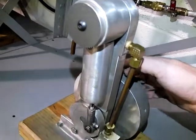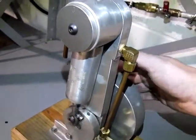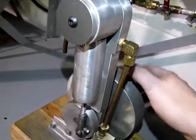It exhausts out on this side here in that tube. And even though it only fires at this one spot, it runs surprisingly smooth. Everywhere else the flywheel must make up the momentum to bring the crank around.